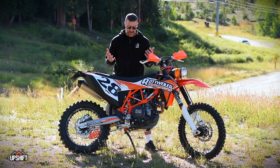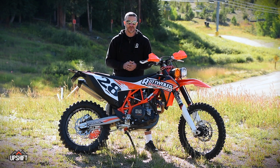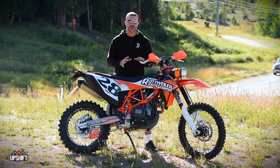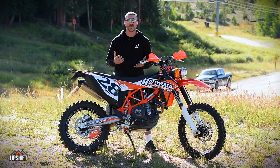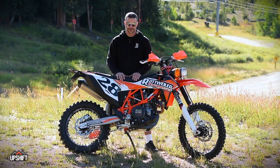And so what we did with this thing is we wanted to start with the suspension. The suspension's a weak point on these things. They only have about 10¼ inches of travel. So we went with the WP cone valve suspension in front, modified and sprung by Conflict Motorsports. So this has a true 300 millimeters of travel. Now it's a bit of a horse to get on, but it's what it's going to take to really rock those big 3-foot whoops down in San Felipe. So we wanted this thing to handle really, really well.